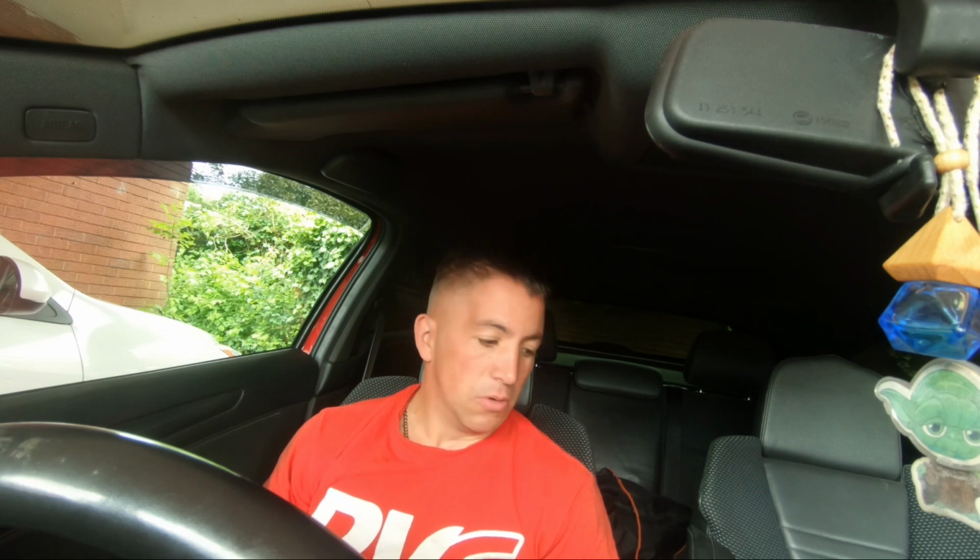It's something I've been meaning to get around to doing for ages, just to get rid of that engine management light. Because it says open circuit, that tells me there's a break in the wire somewhere. So obviously somewhere on the wire that's on it now, there's a break, which is causing the car to think that it's not plugged in at all. So I'm going to do that today.